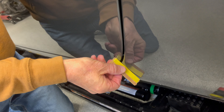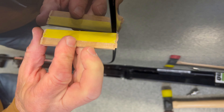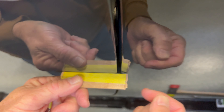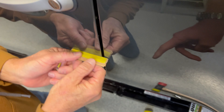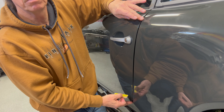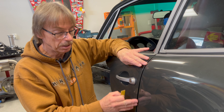We know we're right where we're supposed to be — we're good here, good at this point. Here's where we're not good. You see the middle here? You see that gap? There is nothing that can be done about that, because it's not one of these three fixed points. We're good here, we're good here — everything in a straight line between them, you own it. This is what you work on when you're in mock-up in body work: everything is dialed in at the fixed points. If these aren't working out in mock-up, these are the areas you work on in the shop to get it right.